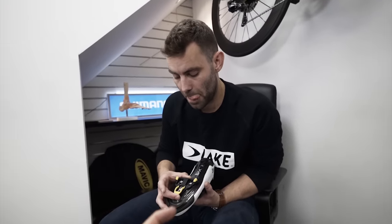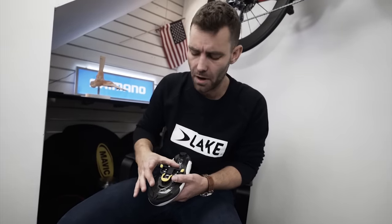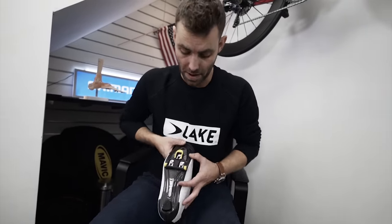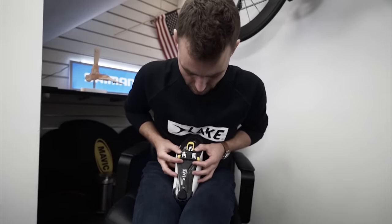You don't want to be running cleats completely wonky. I would run the cleat almost completely straight unless the rider specifically requires rotation. Most cleats have float in them and I would discourage anybody from using a fixed cleat. Some float is always a good thing. Personally I can't tell much difference between Shimano blue and yellow, but I tend to prefer Look grey over red on the grounds that the red has quite a lot of float. Generally speaking, I would set the cleats completely straight as a starting point, running the cleat quite far back and centred from a medial-lateral perspective.